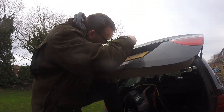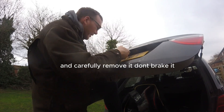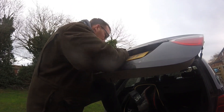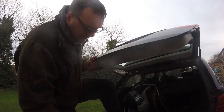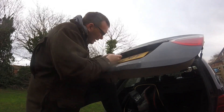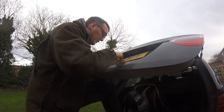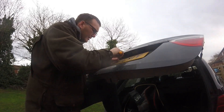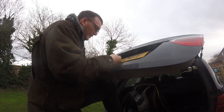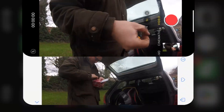You need a small screwdriver to get the boot switch out - be quite gentle because the plastic is brittle and it will break, so just ease it out. There we go. Also worth noting the gas struts are just about done - they'll hold at full height but won't go up on their own. I'm pulling the wires apart and cutting the plastic off to have a look. It's a fiddly little job but parts are easy enough to find and cheap.